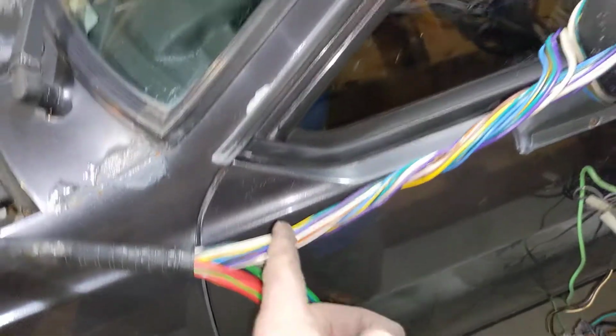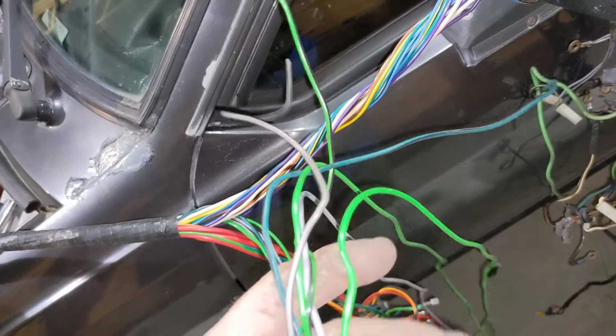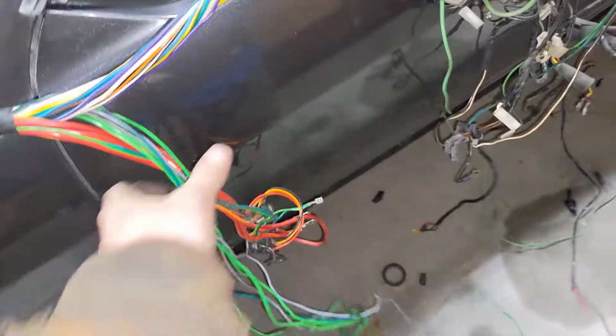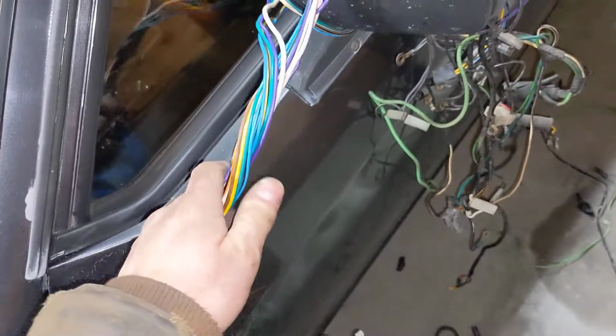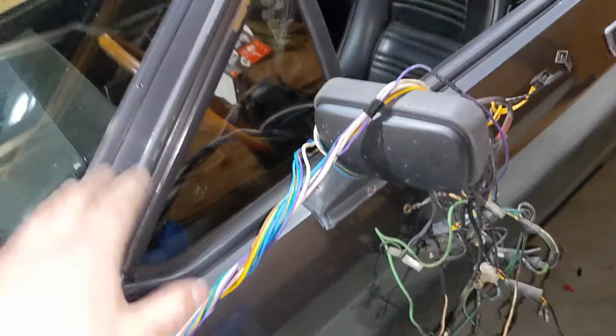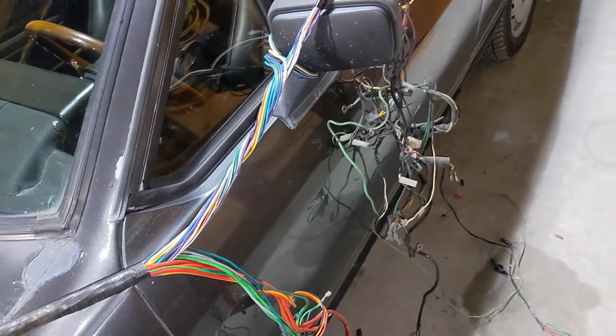Then I'm going to feed heavier gauge, probably 14 gauge wiring, back into the harness to replace this wiring. I think this wiring is probably 16 gauge. To be honest, it's probably adequate, but it had been snipped and it had started to corrode. So I figured I can use this as a signaling wire for the relays, and then just run my own power and ground for the headlights in this harness. So that's the reason I've taken this all apart. I'm going to be taping this all back together with the new headlight wiring and the new ignition system, and then it should look like nothing happened.